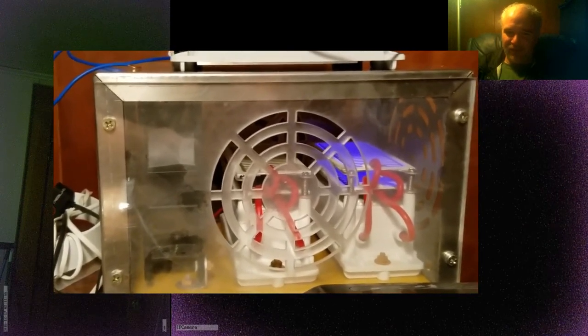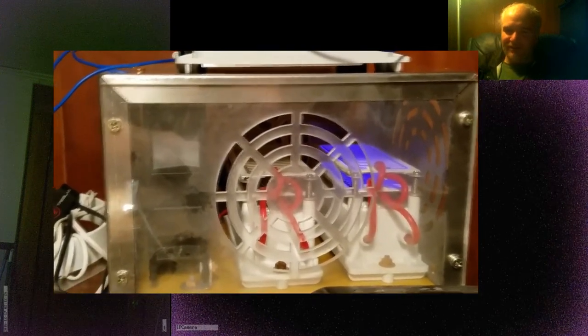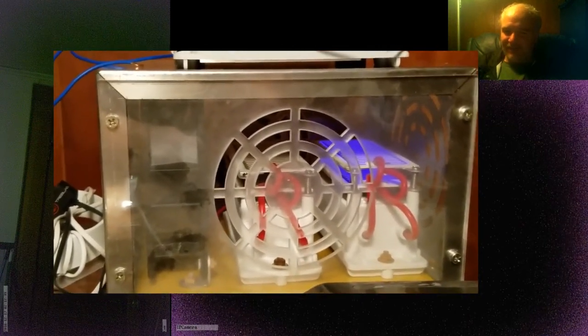And so not only did I have to replace this set of plates in this transformer because they were totally dysfunctional, I also wanted to replace these ones that were partially working because they weren't putting out as much ozone as when I first received them, which is typical: the longer you use an ozonator, the less and less ozone the plates put out. And it's not just related to the plates, it's actually the plates and the transformer both degrade. I think it has a lot to do with the amount of heat generated by the ozonator and the transformer across a lifetime, which is not very long. Almost immediately the plates begin to put out less and less ozone, and across a couple months it tracks down so significantly that you want to replace the plates, and probably the transformer too.